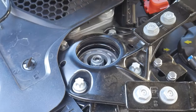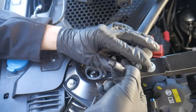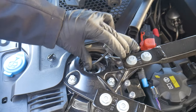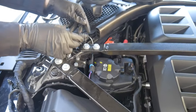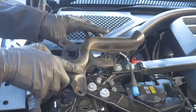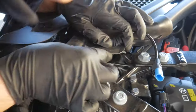Once the assembly is back in, reinsert the 19-millimeter 12-point top nut and tighten it down. Reattach the EDC sensor. Essentially you're just reversing all the steps you did to disassemble. Reattach the various plastic liners and covers, which are fastened either by pop tabs or the twist tab already on the plastic piece — it's labeled so you know which position is locked and which is unlocked.